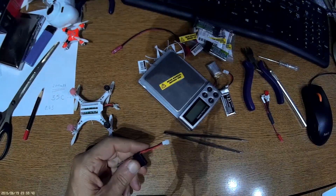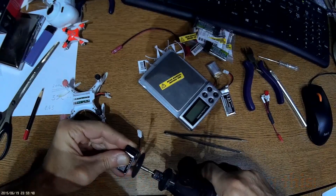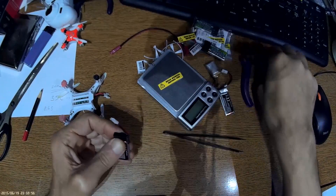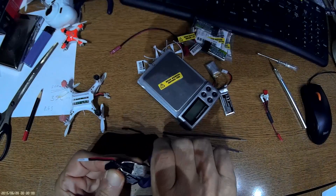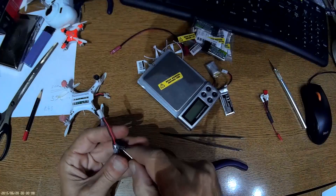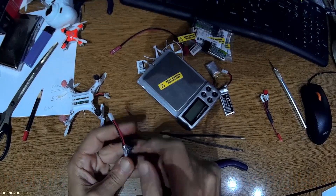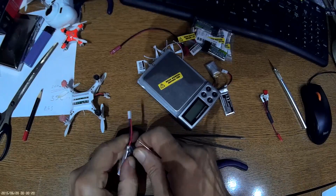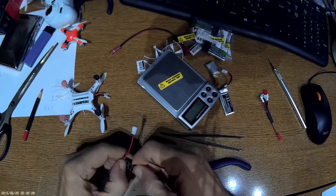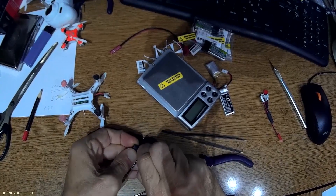Use a Dremel or similar tool to remove the housing. Be very careful. Just begin slightly, cutting open the end edge of the battery. Inside is silicone — carefully unpeel the silicone from the black plastic side, not from the battery side. Remove it very carefully. Be aware that the battery itself stores a lot of energy, so it is not good to short or damage it.